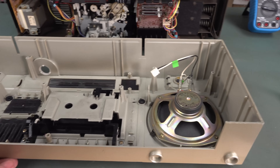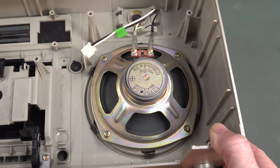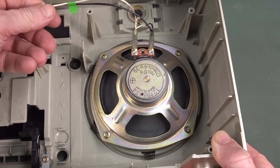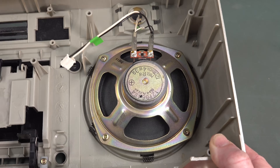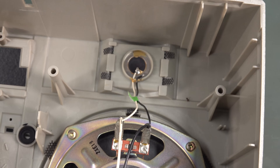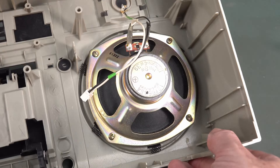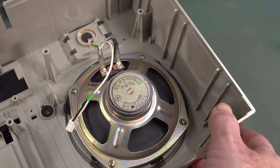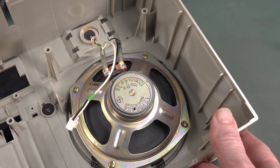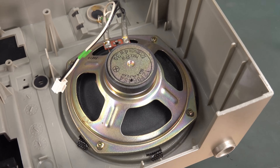The speakers — of course they're Sharp-branded, 8 watts maximum. None of that peak music power output rubbish: max 8 watts, 4 watts, 3 ohms, 120mm. And yes, as was common back in the day, a piezo transducer for the high-frequency stuff. There were a lot of fakies back in the 1980s that would physically have the grill and even put fake metal in there to make it look like you had a tweeter, but it was actually a full-range jobby. But the speakers are still in very good nick.